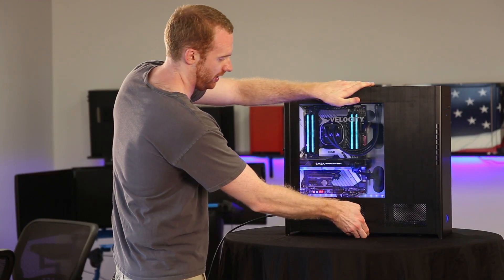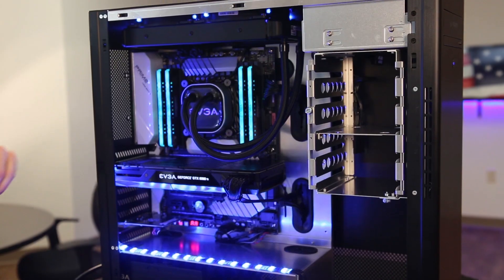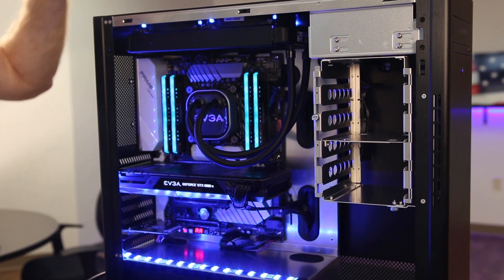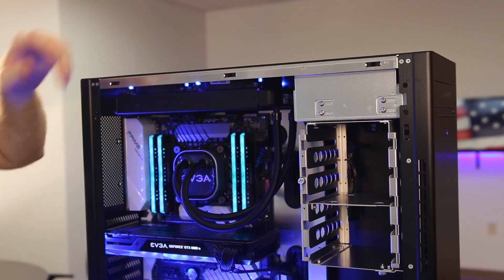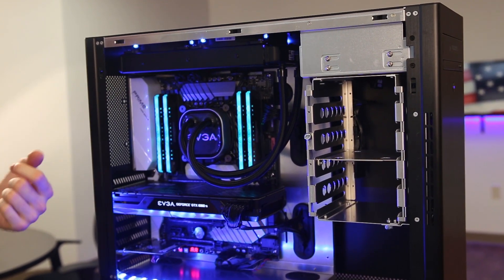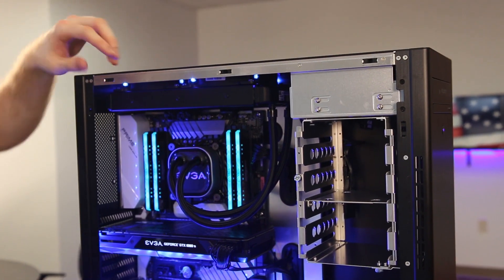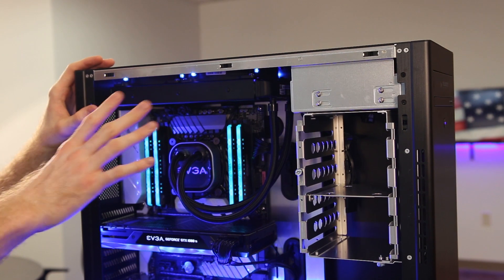We're going to start by pulling off the side panel like so. The important areas to watch for are going to be the top fans — in the case of the GX4 and MX3 it's going to be the side fans right here. You're going to make sure you use your air compressor or can of compressed air, blasting from the top end of the case as well as from the bottom out of the case. Make sure you get all the dust out of there.